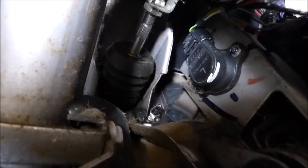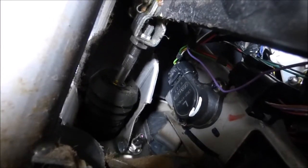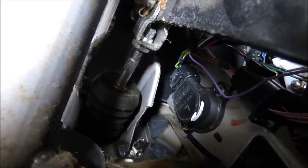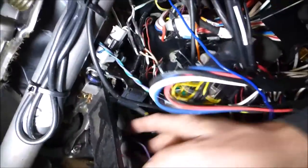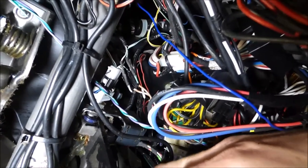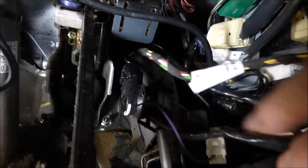As you can see, that there is your electronic throttle sensor. You'll have to unplug that and take the four wires. If you bought a brand new kit, you'll have to take the four pins out of that plug and plug it into this here — this plug that they tee off to the harness. Then plug in the actual plug that is supplied, which fits on that throttle sensor up there, and it'll plug into that tee piece.